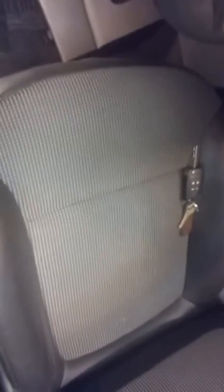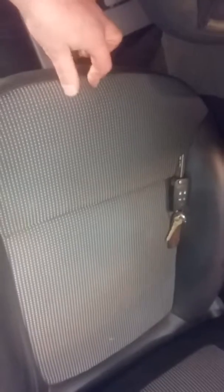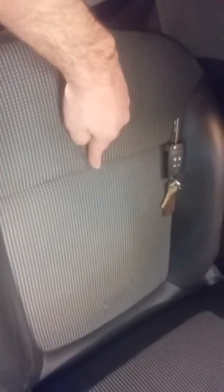What you got to watch is, make sure you get it to where when the seat's all the way in, you're still clearing the wires that go through there. The only thing I had to really change on the seat to make this heated seat insert work was this center hog ring right here. I did have to remove it, had to trim a little bit of the element to clear these two hog rings. Element goes clear back in here, so butt coverage is good.